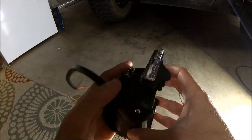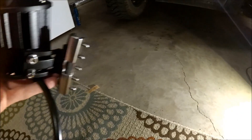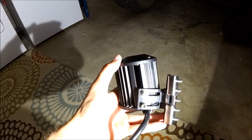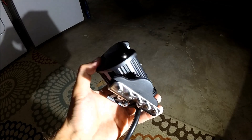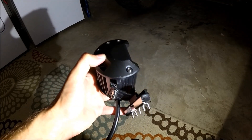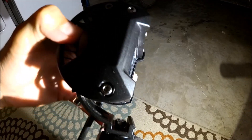These guys aren't that bad to install. This bracket comes with the light, and here's how they bolt up: you tighten those two allen screws with the little T-nuts and adjust it where you want it, then the set screws clip onto the seam of your hood so you can adjust and mount from there. You can see there's a lot of adjustability — depending on what you're running, you can go low or you can go high.